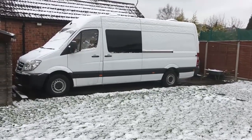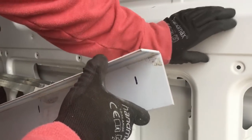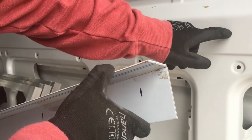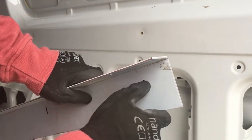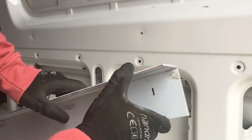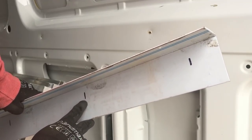Let's get in there and get cracking. What we've had made is a folded aluminium angle. This angle is going to get bolted to the main structural member of the van. I'm going to drill some holes and then we're going to put some rivnuts in here — 8mm. We're going to drill the aluminium angle with an 8mm hole and then put some high tensile bolts through the aluminium into the rivnuts in the main structural member, and that's going to hold it nice and securely to the van. I've pre-marked where I want the holes to be on the aluminium angle and I'm going to take them into the workshop and drill them first.